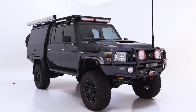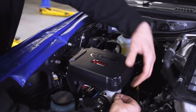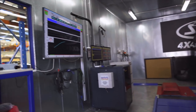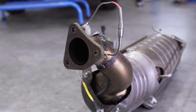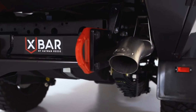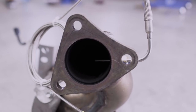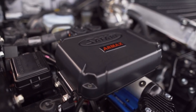This is a great thing to help with the longevity and reliability of your engine. At the other end of the scale, when you've got a big hill to climb on a hot day and things are heating up, the ECU is measuring the exhaust gas temperatures and dials back performance to reduce damage on both the engine and the DPF. The DPF is a diesel particulate filter, and it's an important component of today's vehicles. If we're not measuring exhaust gas temperatures on a diesel, we could end up melting the DPF, leaving you stranded in the middle of Australia. So the fact that Safari are measuring exhaust gas temperature is one of the most important components of this ECU.